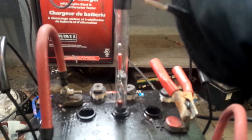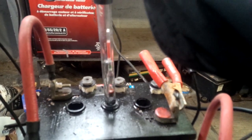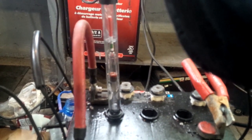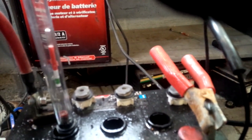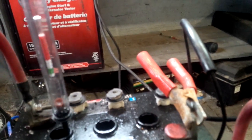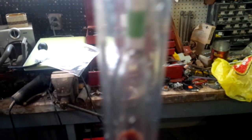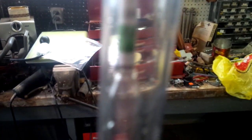These are all reading roughly around 1.250 — I keep saying twelve but it's 1.2-something, so it's easy to slip. You just bring your level up and see where your gauge is. I'd give you better readings but my camera doesn't do close-up, but it doesn't really need to be. It's pretty obvious: if it's in the red it needs to recharge, if it's in the white it still needs recharging, and if it's in the green it's probably good.